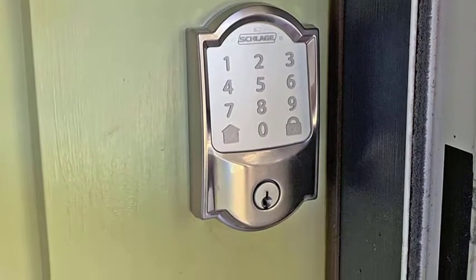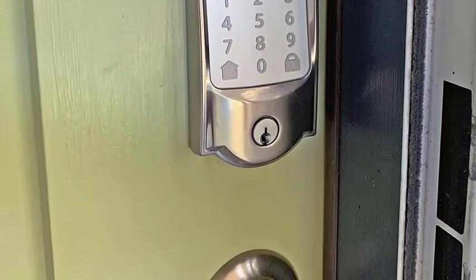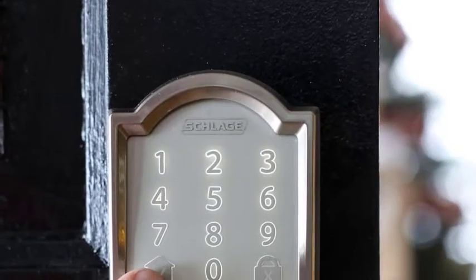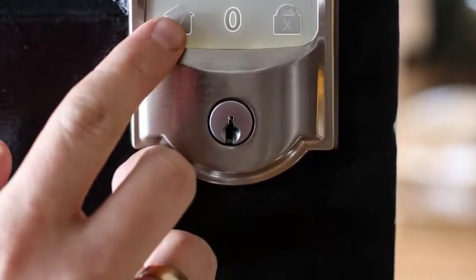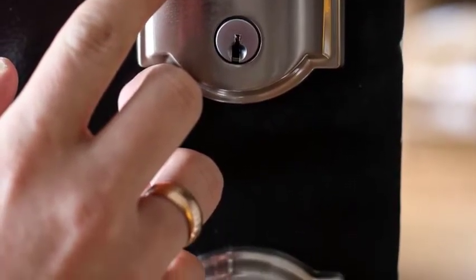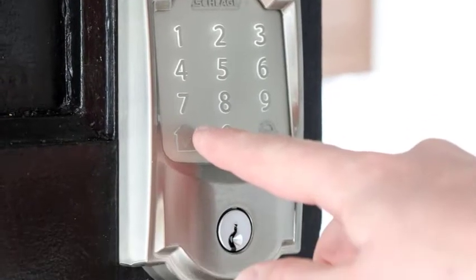The interior escutcheon measures 5.5 by 3.0 by 2.2 inches and contains a thumbscrew knob for manual locking and unlocking. Beneath a removable cover are a battery compartment for 4 AA batteries, a pairing button, an embedded 2.4 GHz Wi-Fi radio, and a tamper alarm.